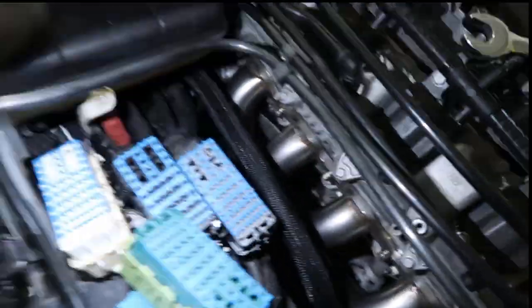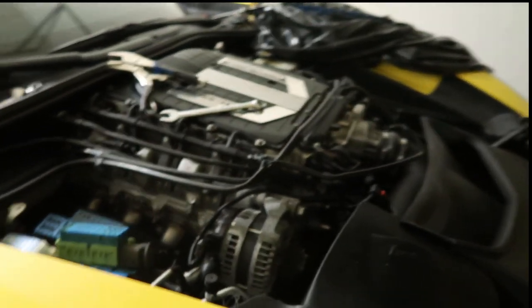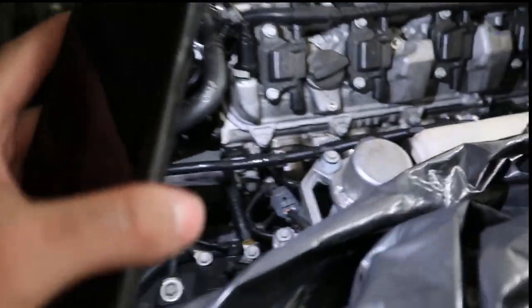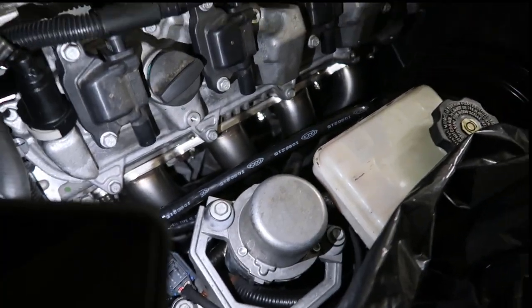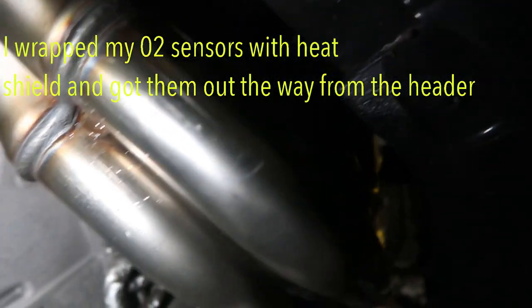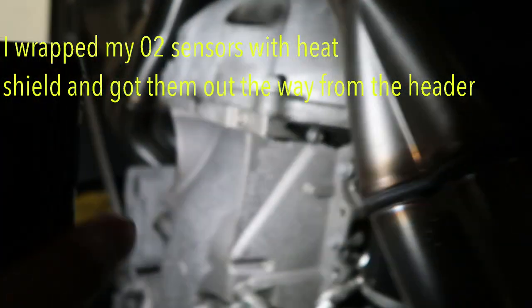She's looking all pretty right now. The driver side is, I think, easier. I did not have to move the steering rack. I also forgot to mention: I removed the starter shield — make sure you put it back after you put the headers on. Make sure you also get the O2 sensors wired up and secured with clamps or whatever you want to use.